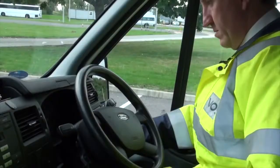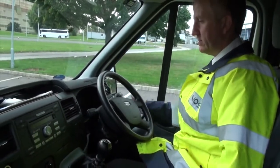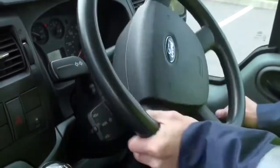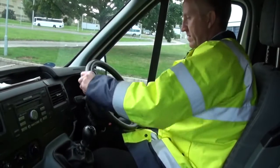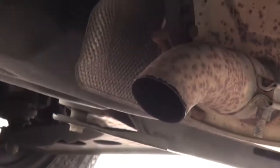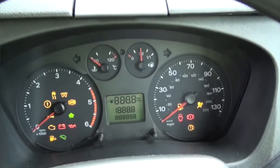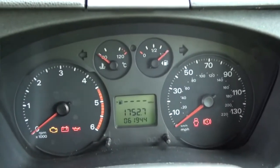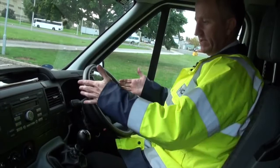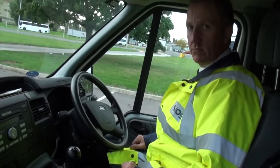Start the vehicle up with your foot on the brake pedal — it should dip a little for the servo. Check that the pedal is not creeping down, and check the power steering — that should be okay. Check for any signs of excessive smoke from the exhaust that may indicate engine problems. Whilst driving, keep an eye on any warning lamps on the dashboard indicating a fault; if it does, get it reported and rectified as soon as possible. Check the feel of the vehicle — the steering, the brakes — is it driving correctly and not wandering?